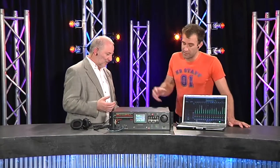So it records in what format? It records in broadcast wave format, 24-bit, at either 44.1 or 48K — industry standard file format that you can pull off. The internal drive in this is 500 gig; it's not SSD, it is a hard drive. But on 500 gig you get about 24 hours worth of recording, assuming you stack every track on.